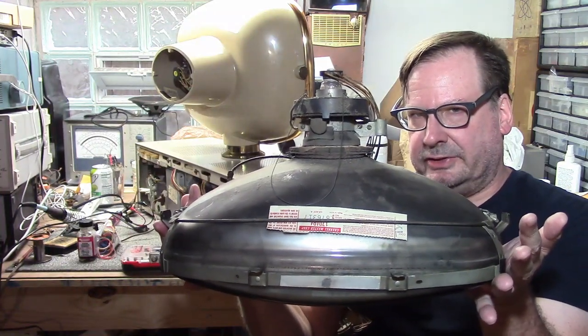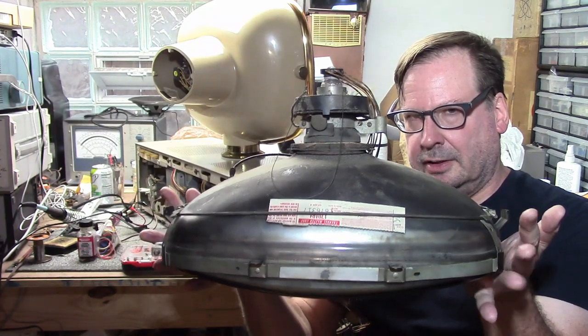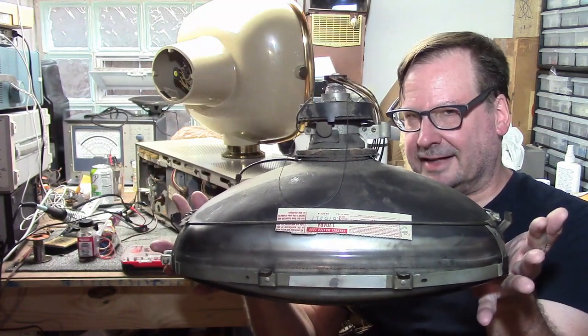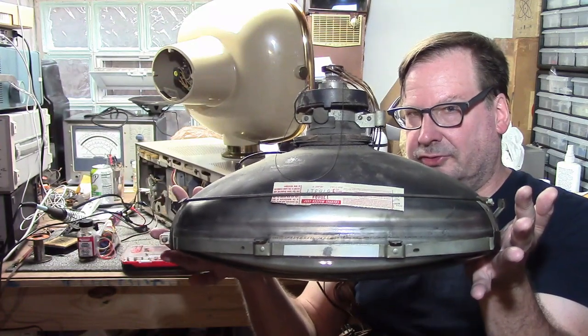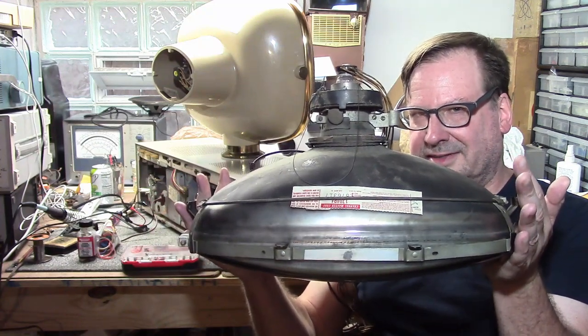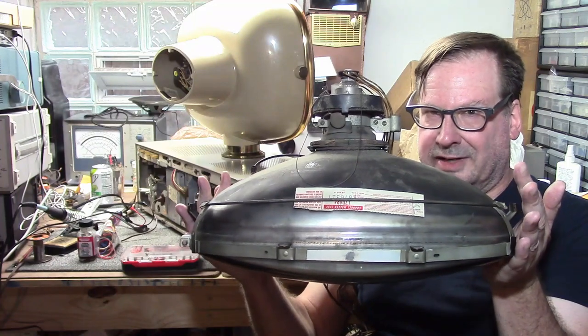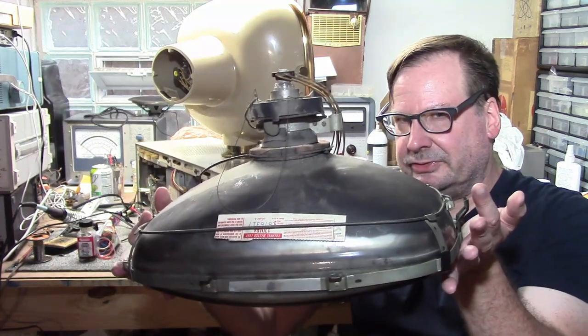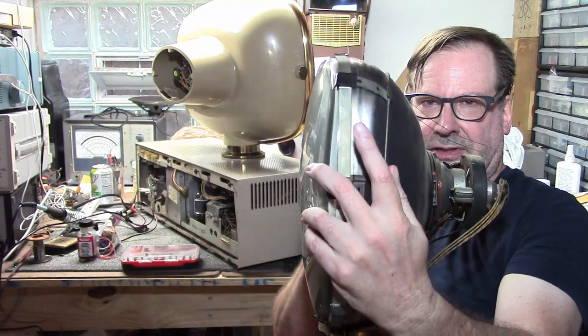Let's start off by talking about the unique physical characteristics of this picture tube. Philco invested a lot of time, money, and effort into creating these. They called them semi-flat. While this may not look flat to you, it sure is compared to earlier generations. They call that the deflection angle — this is 110 degrees. Earlier generations were 90, 70, 54. In fact the earliest picture tubes had such a shallow deflection angle, they had to mount them vertically in a cabinet with a mirror and a lid at a 45-degree angle, otherwise the cabinets would have been completely impractical. So these really short, semi-flat picture tubes is what allowed them to put them in unique enclosures, like with the swivel head.